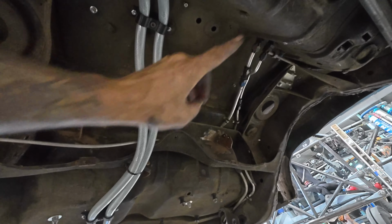Like, obviously I'll take this line off, and then we can be careful with the fuel line. But I think if we could do that, there's enough room on the backside that this whole chingadera should just come out, and then that leaves this intact, and then I can come back here and kind of radius that, but that'll leave this structure here. This is for a spring pocket, but this is a body mount, and then this is giving this some rigidity on the frame, so I'm kind of reluctant to, we'll just kind of leave all that intact.